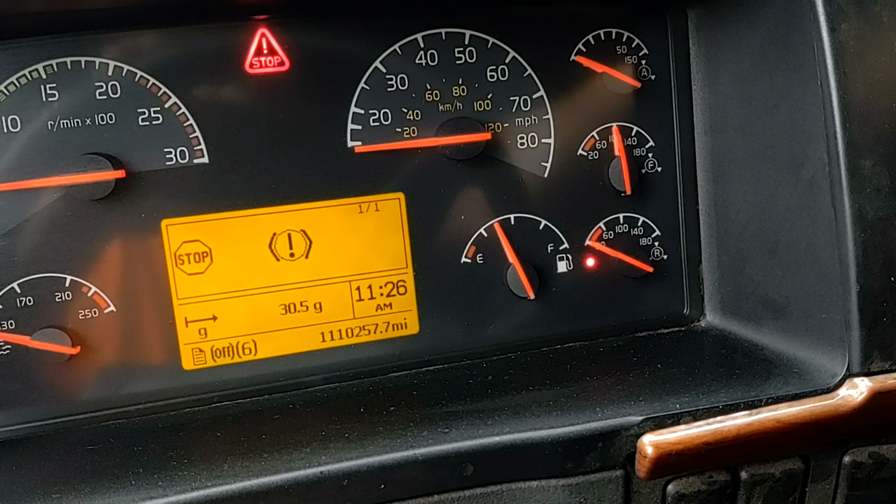All right, guys, this is an air hose that you air up your tires with, that hooks on your glad hand on the back of your truck. I pulled the air chuck off of it, put this fitting on there, go connect it to my shop air right here, like so. And I've got it connected to the glad hand on my trailer out there. I turn the valve off on the compressor over here.